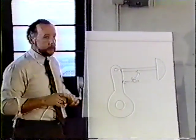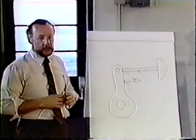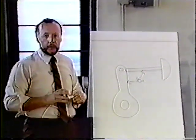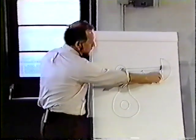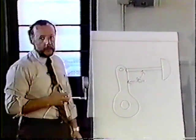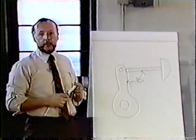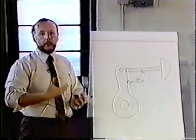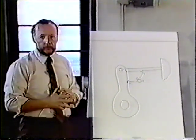What's maximum stroke? That depends on the chamber itself. For instance, a Type 30, maximum stroke is 2.5 inches. 2.5 inches between here and when that push rod makes its full travel out. We want 90 degrees at 1.25 inches. A smaller chamber, less stroke. A larger chamber, more stroke.